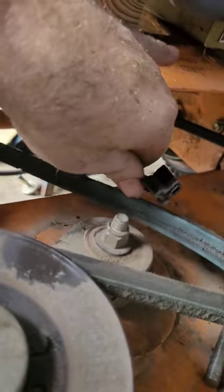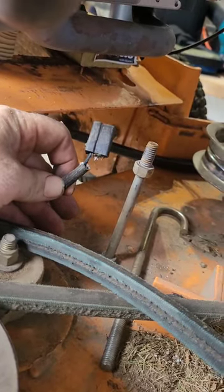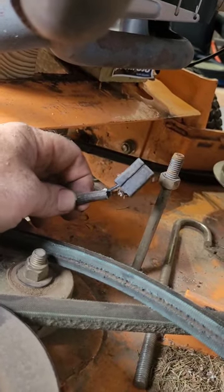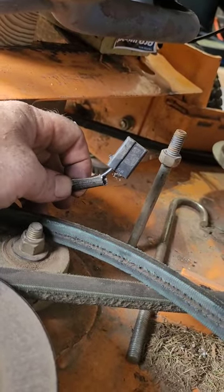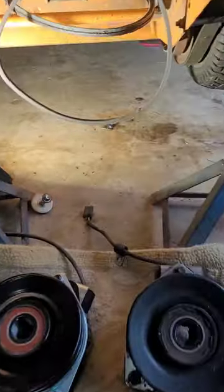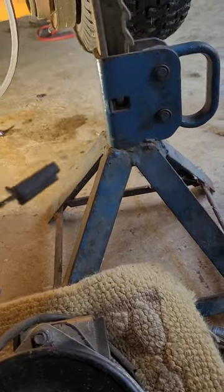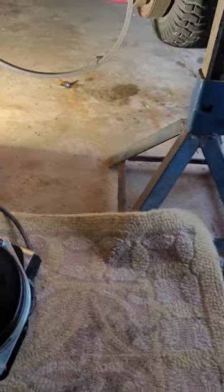I don't know why my PTO randomly started to stop working and clunk out, but the second wire somehow shaved itself off. I'm not sure if I didn't put it back right when I reinstalled this brand new engine. Either way, it was finicky — it would heat up and start turning off. So I don't know if it was chafing the whole time, but that's why it failed.